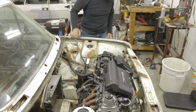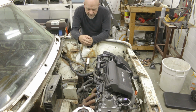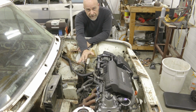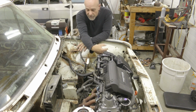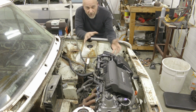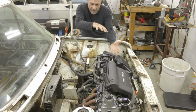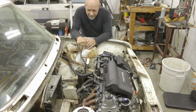Right now, I don't see it right in front of me. Is the acceleration, or is the torque rod that manages when the engine is under load, acceleration or deceleration. It wants to kind of turn on its engine mounts. When you're accelerating, you got the wheels going this way, so the engine has a desire to kind of roll back in its engine mounts from torque.